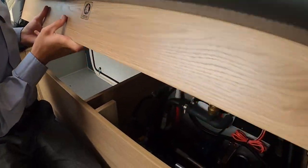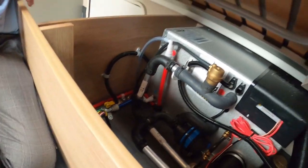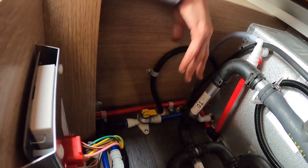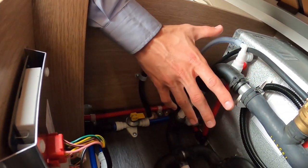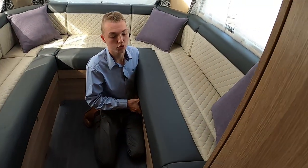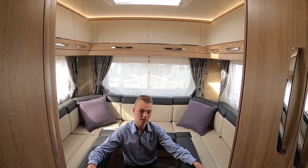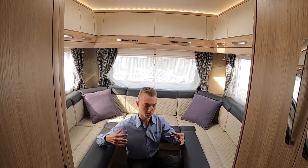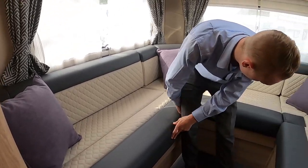Underneath the passenger-side rear bench seat you've got your main drain tap — this is the main drain for your boiler, which holds 10 litres of water. In winter you don't want it to freeze, as it's not covered under warranty — it's your responsibility to drain it. With the pump off, lift this tap and the water cascades out under the chassis. Come back in with no power and no pump on so water isn't pushed back into the boiler. When reusing the van, put the tap down, fill up, and you're good. When winterising, open the tap, open your fresh water drain, open your grey waste, and open all mixer taps inside to the middle position to prevent airlocks.